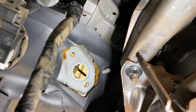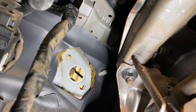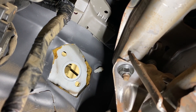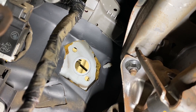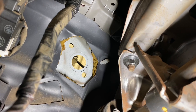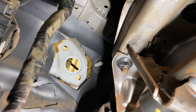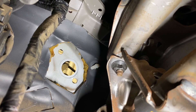The holes are drilled now. I did cut some of the insulation out around this pedal area, and you're going to want to do that because you need extra room to get the pedal installed. I might have to trim more than this, but it's good enough for now to have drilled the holes. I may need to trim a little more around the edge so the pedal bracket itself fits back in against the firewall.